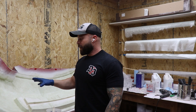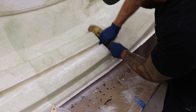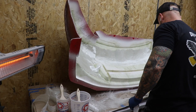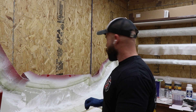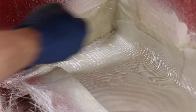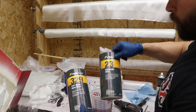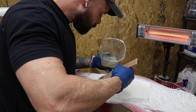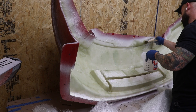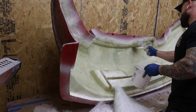We've allowed the bumper to cure for one day to make sure the gel coat is not going to alligator. We've gone ahead and knocked down any of the little pointy bits from the chop strand mat. Now we're going to measure out areas for the fiberglass cloth and spray tack it down. With our fiberglass reinforcements laid out, we'll do our final layup with resin — this requires a wax additive. We're also going to reinforce some of the tougher corners with build glass fibers and use a peanut butter putty, which is silica and milled fibers mixed with resin to a peanut-butter consistency. Then we'll do fiberglass cloth followed by more chop strand mat in difficult areas, so the mounting points are thick and strong enough to handle putting fasteners through.